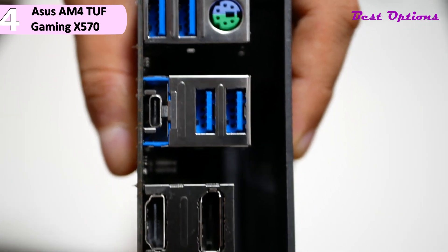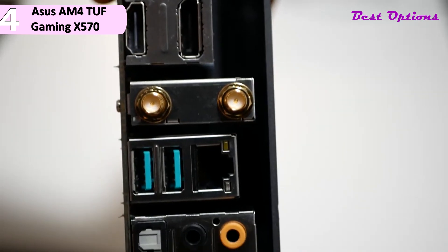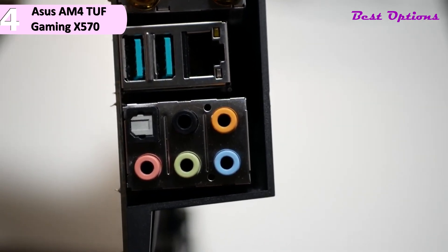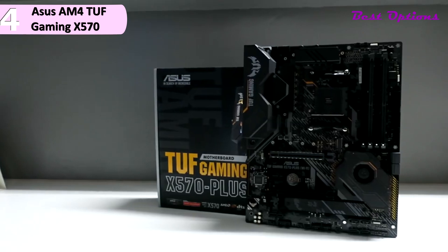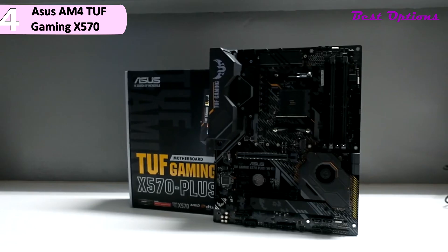This gaming motherboard layout is excellent with no major flaws or issues. Aside from the SATA connectors, the headers and port placement are quite good and marked reasonably well. It has one CPU fan header, one CPU option header, one AIO pump header, and three standard 4-pin fan headers, all of which support DC and PWM control modes.